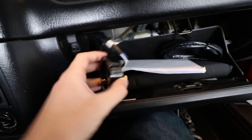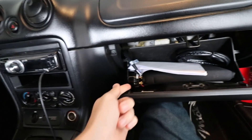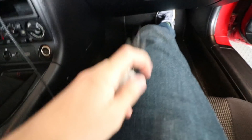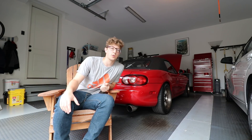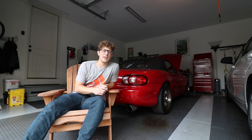The only other thing is the wideband gauge. Inside the car there's not much difference. The placement of the gauge is pretty interesting and very stealthy — it's just stashed right in the glove box. It's important to note that this is also ran to the ECU, which provides the ECU with the air-fuel ratio reading — very important. It uses a serial port and I have a little converter that goes into a USB. That's a pretty simple explanation of the ECU and what it takes to run it. My brother's write-up will be in the description.